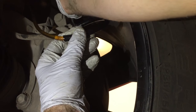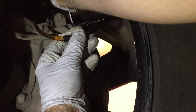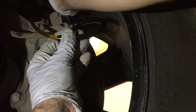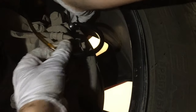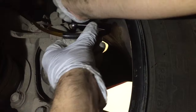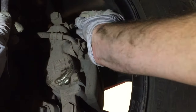She's pumping the brake three times and holding the pedal. We're going to go ahead and open and close. One more time — pump three times and hold. We go ahead and open and close. This wheel is pretty good now — go ahead and remove our tube and replace our cap.